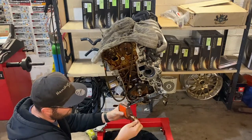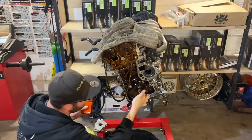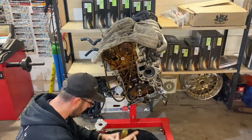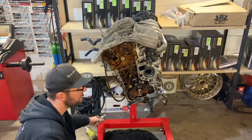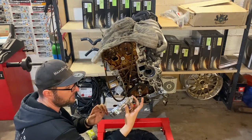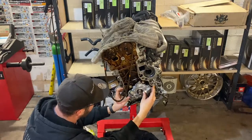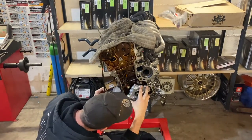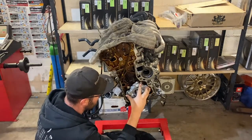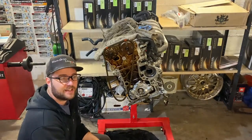All things you put together have to be really nice, holding together well and have a lot of lubrication. Instead of installing everything dry, you can put this kind of lubricant on it — it's just a safe thing to do. I always do that when I assemble engines. Also really important: since this pump is brand new and has no oil in it, it will be really important to get the oil pressure up and ready before starting the engine.